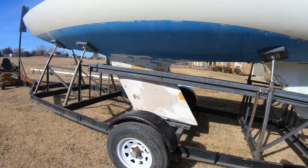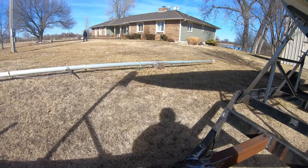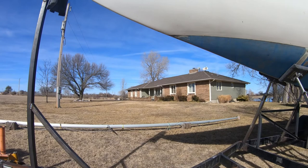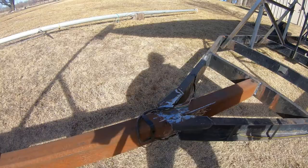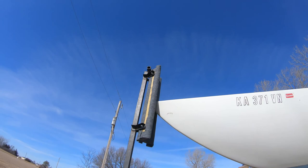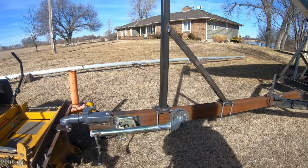Trying to make this trailer foolproof — too many of these deep keel boats are very difficult to put on the trailer. Another trouble we had is the hitch ball coupler used to be right here, and the bow was sticking 32 inches past the hitch ball. With my pickup that would work, but it made it a little dicey. Plus I couldn't put a bow stop on there. So this rusty beam here — we'll have to sandblast it — this is a new tongue extension. We extended the tongue an additional six feet. Then we put a bow stop up here so that you know where to stop putting it on the trailer. We've welded the hitch coupler on there and welded the tongue jack on there.